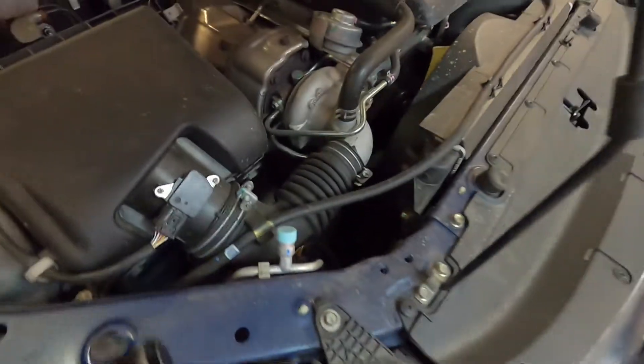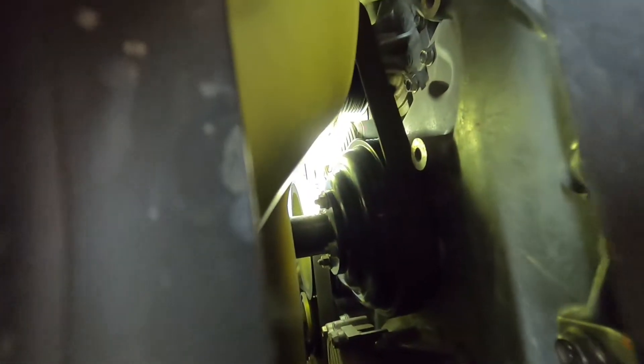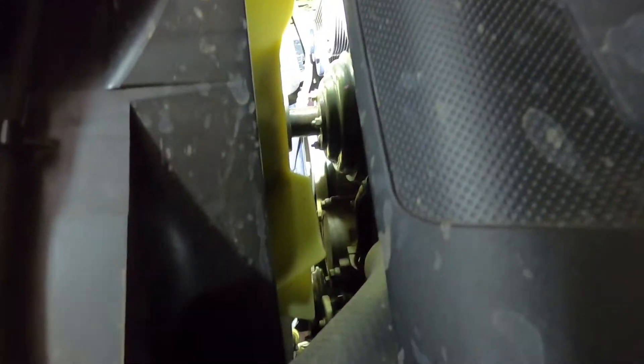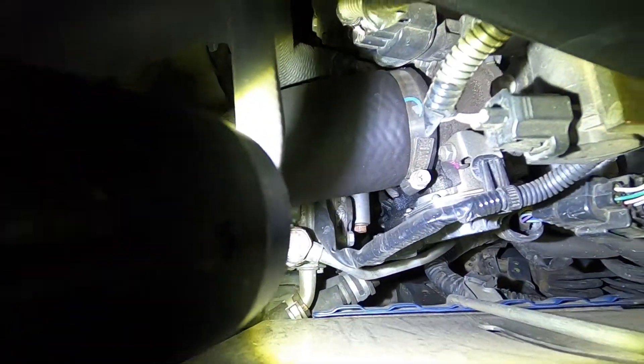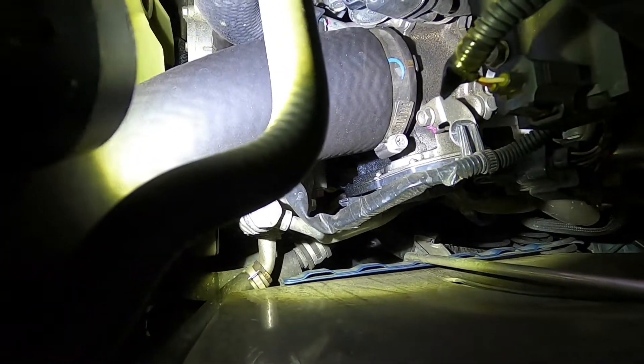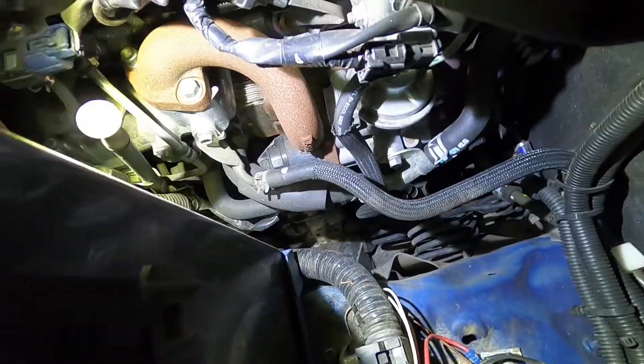We just go around the car and have a look, make sure nothing's leaking that needs attention. Now check your drive belt - you normally check on the inside of the belt where the ribs are, checking for cracks. This one doesn't have cracks, so this belt's fine. That's not your timing belt - a lot of people think it is. There's a little bit of oil residue around the intake - nothing over the top, diesels do get a little bit of seepage there. Check all your hoses, make sure no coolant is pushing through the sides.